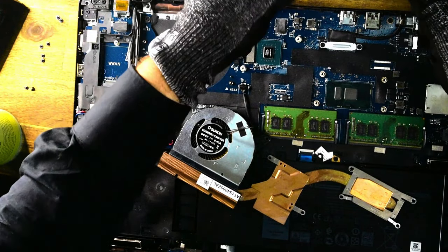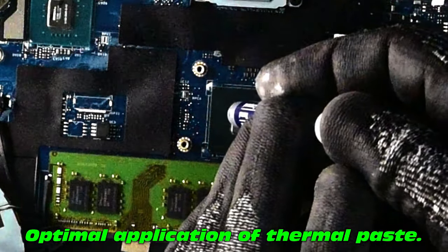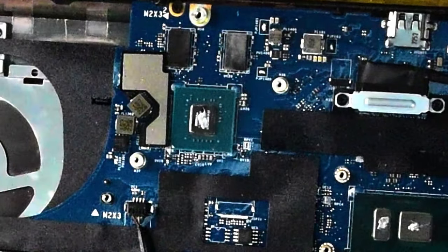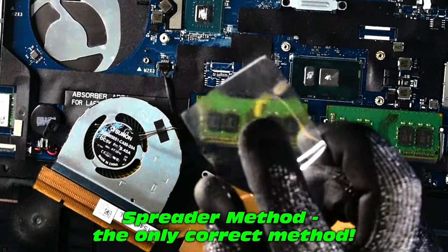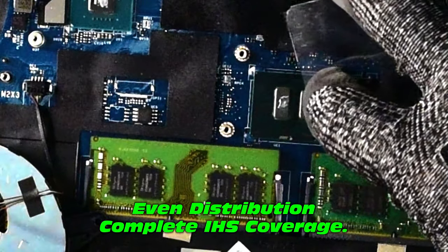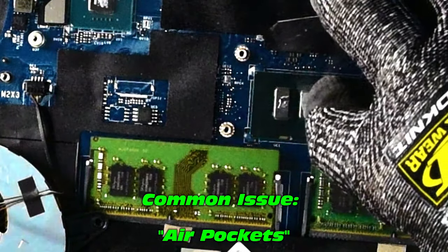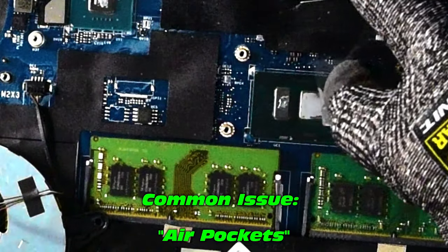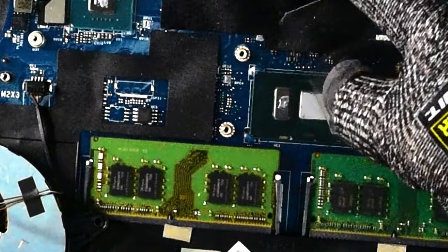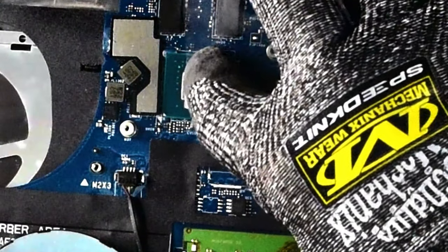In terms of application, there's lots of controversy but there really is only one way: applying a small dab on each of our surfaces, then using a nice clear spreader to spread the thermal paste. I know it's laborious and takes a long time, but it gives complete coverage of the IHS — the integrated heat spreader — of every single chipset. Yes, you might be thinking air pockets are a problem with the spreader method — but they're easy to avoid. Just put a little dot right in the middle and any air pockets will completely fade away.